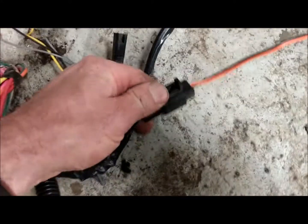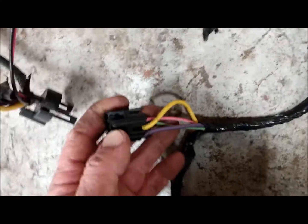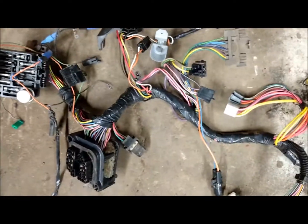The difference I saw was that they made a connector for the cigarette lighter on these that runs over as a pigtail. Because it's an automatic it has another part that runs down by the heater under the carpet to the console shifter — the illumination light for your shifter, your lockout, and your reverse light on your shifter. They're quite similar, just a few little changes here and there between the older and newer stuff.